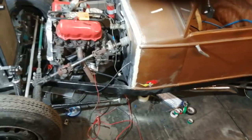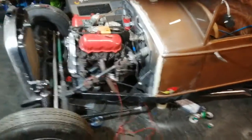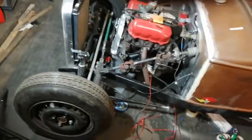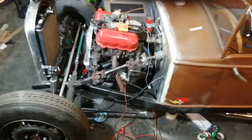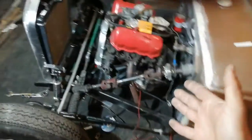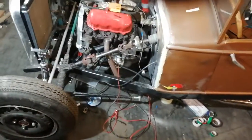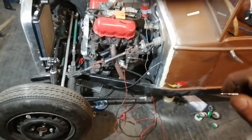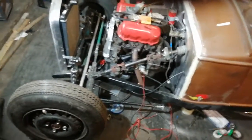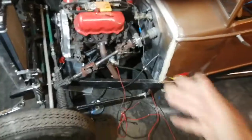So that's what I wanted to say, and it's a disappointment first of all because I couldn't make the video. I thought I would have many more expenses repairing and converting that to 12 volt. But the good thing is that the most expensive part, the starter, is already 12 volt. I heard that a 6-volt starter will run on a 12-volt battery, but you shouldn't run it for a longer time to start, just make stops between, or it will burn down. But luckily we don't have to care about that. I have 12 volt already built in.